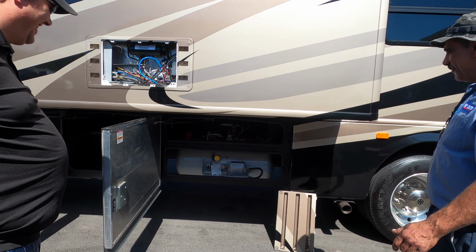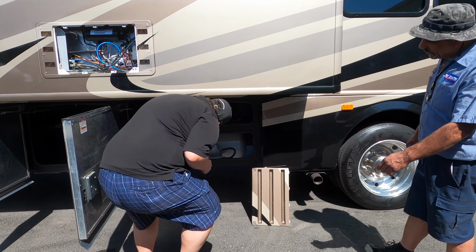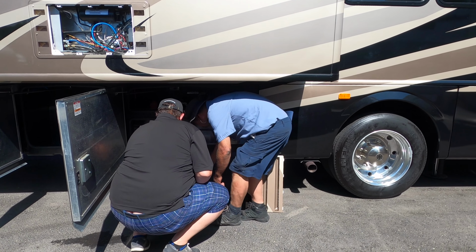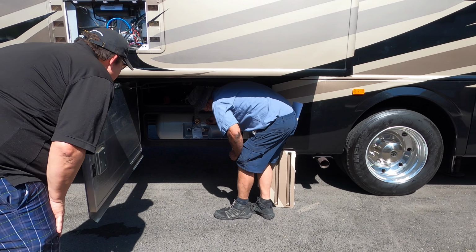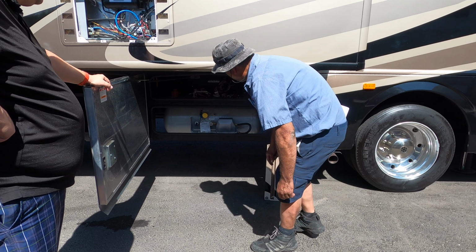Break out another 1,000. But that's the fill right there. Is the yellow cap? Or no, that is the fill. When you get to the station, they will connect you. Oh, that's okay. And this is the 80% valve. They crack this, and you get liquid. Right now, I see a little bit of liquid there. Yeah, it was misty. That's full when you get liquid at that point.